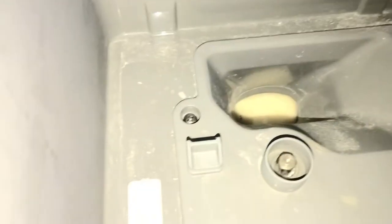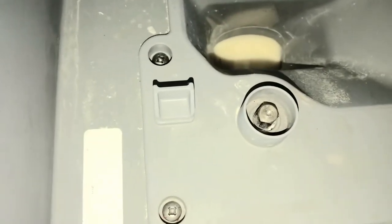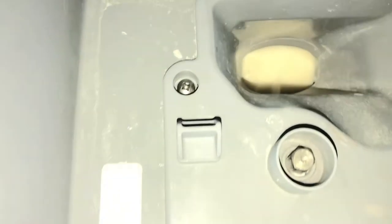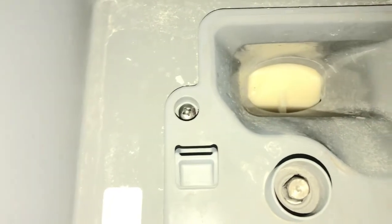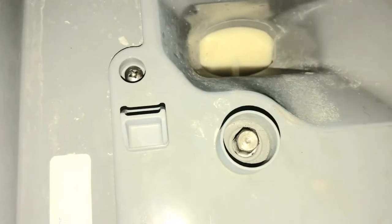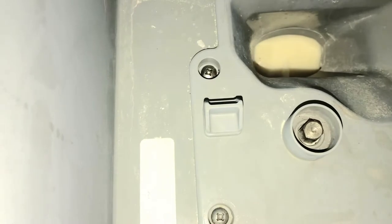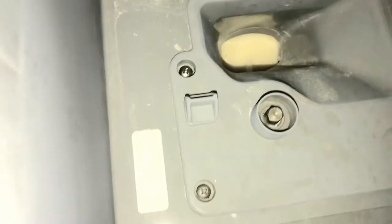You're going to have four Phillips screws, and after you remove those you're going to have four quarter-inch screws. Remove those and once you get those out you can pull the auger motor out. We can examine it and see what's wrong — chances are it's frozen.